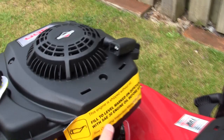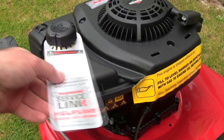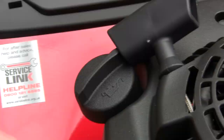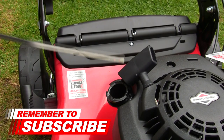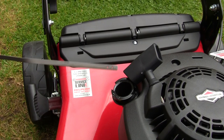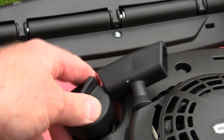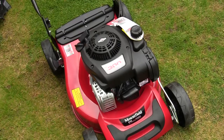You will need to purchase some oil as it's not shipped with the mower - it says SAE30 on the back and I'll link to that in the description. It's usually around half a litre of oil that goes in these lawnmowers, but you'll need to measure it on the dipstick. The oil goes in here. Check the dipstick - there may be a little bit on it from factory, but clean it off and fill to the correct level, which should be between the two marks on the dipstick. Thread it in and pull it back out to check the level.